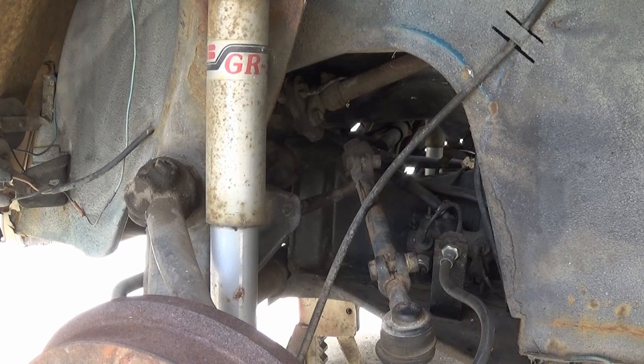You just want to make sure when you tighten that adjusting screw down, or adjust it, whatever it is you're doing, that it doesn't bind up at some point. And at some point, you just have to admit, hey, it's time for a new steering box. And what do they call the arm underneath the steering box? Is that the pitman arm? The boxes have two different sizes. They have the early and the late, and I'm not sure which year they changed. This is the first year of the ball joint, so this may be the year they went to the bigger one. So be sure and be aware of that when you order your box.